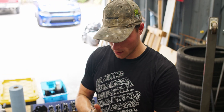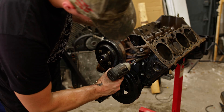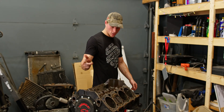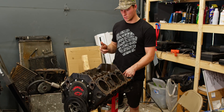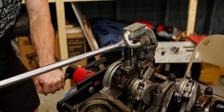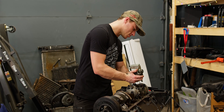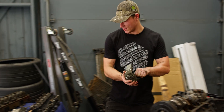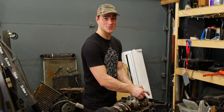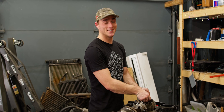The best course of action now is to pull off the water pump. We're going to keep the balancer on there for now so we can still turn the engine over. So we'll pull off the oil pump first. And then this should come off just like that — the heart of the engine right there, folks. If you want to see us install that while the engine's in the car, check out our video on that.